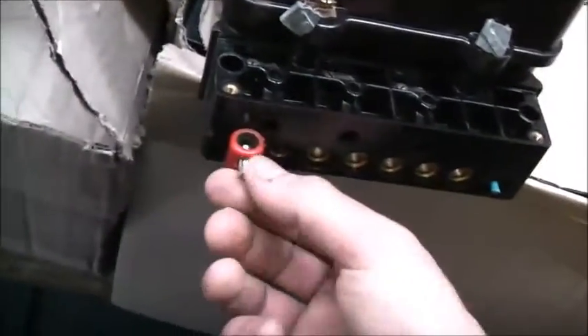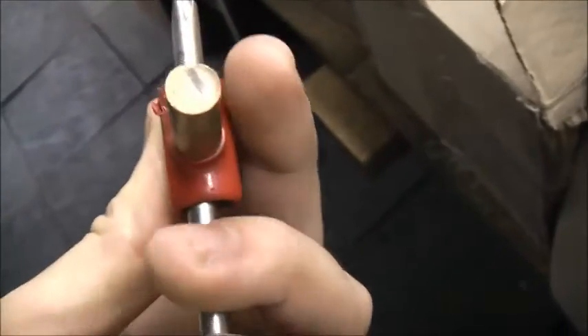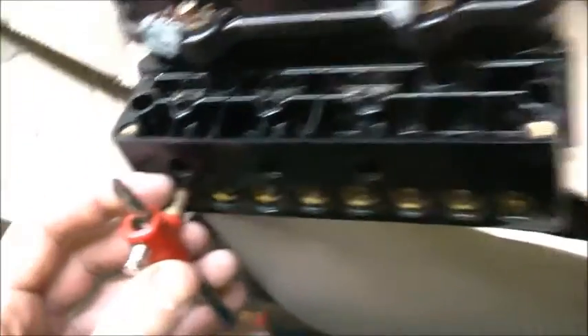Let's make an attempt at getting this bolt out. I'm going to pull this wire apart, pull the strands out individually. That top one's loose — hopefully we can get this bottom one loose. It's broken. I'm going to try and get a good pair of pliers to undo that screw and loosen that off. I got it out just by clamping the screw over it and twisting it carefully, without breaking the bakelite that this is screwed into. Just rock it backwards and forwards and put a screw over between the solid part of the casing — rock it out and it pulled out. That was pretty easy.